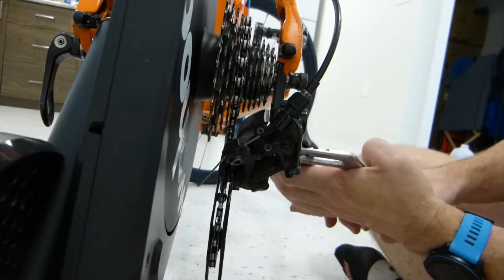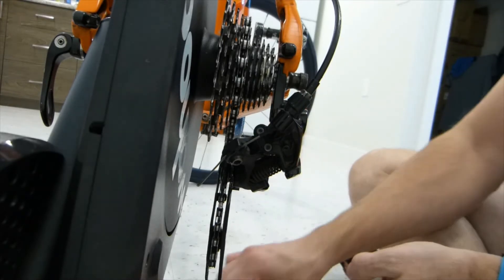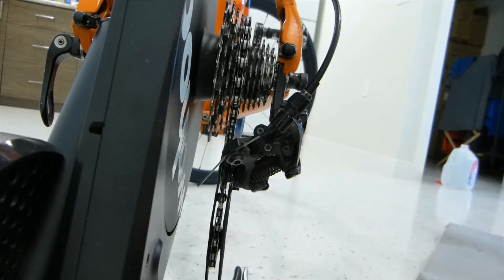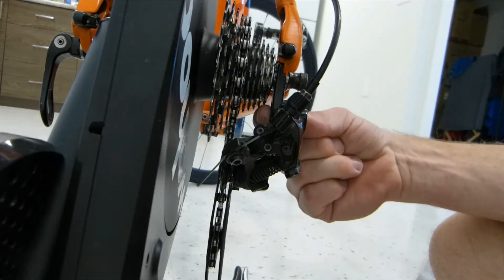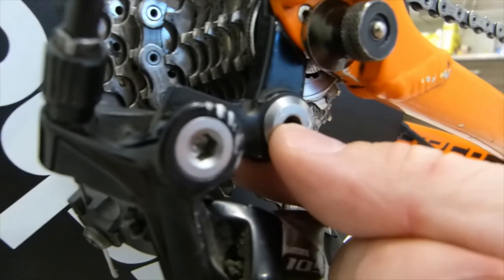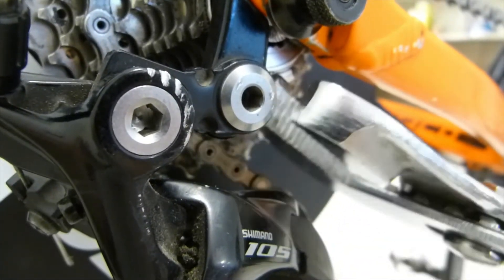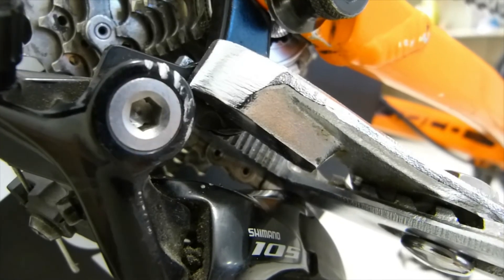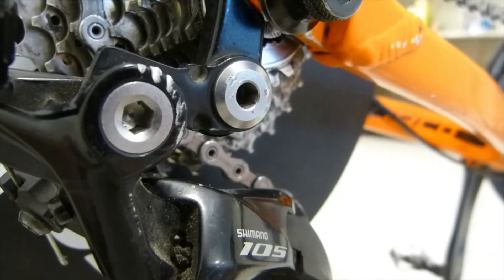It is going to have a little bounce back, but it can be done carefully, a little bit at a time, with reasonably small force applied. But you do have to have a solid grip here at the bottom of the derailleur hanger, bending it out. Now this can also be twisted side to side, so just watch what you are doing.